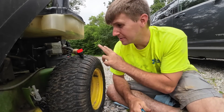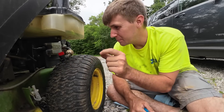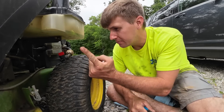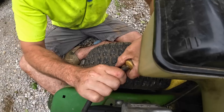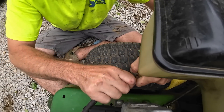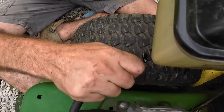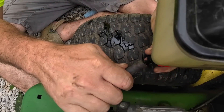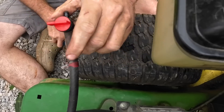The good news is the inline fuel filters I buy and keep on hand also have two different size barbs for the fuel line. So we'll just slide the fuel filter upstream of the valve and the valve downstream of that, and that should work. It does say it's directional, so I am following that — can't imagine it matters too crazy much.